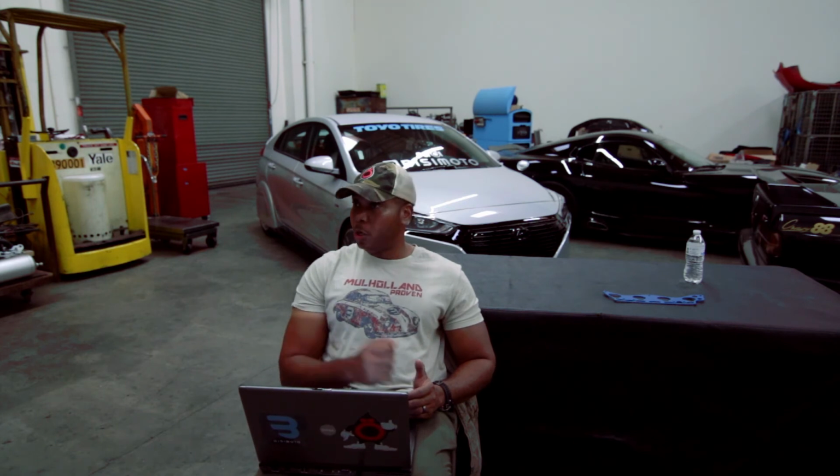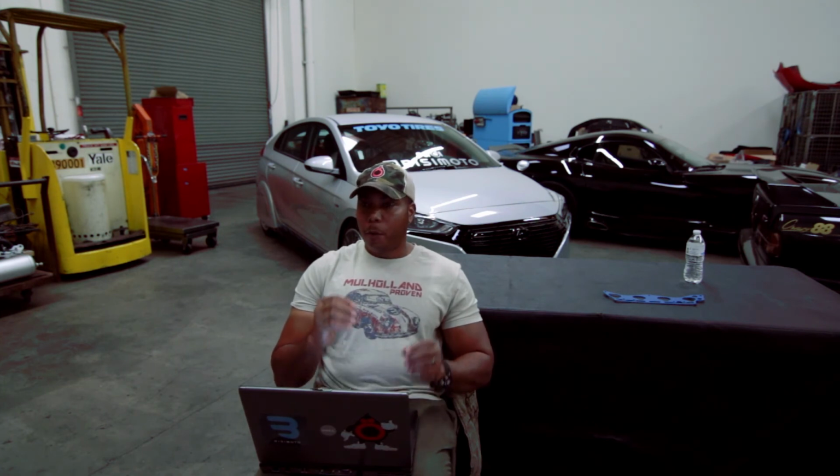And fast forward to today, he mentioned the IGBT coils from AEM, one of my partners. That coil pack is ridiculous. I make a joke sometimes that it could combust water. It cannot, but I'm so impressed with how, I think it's over 135 millijoules of energy. It's very, very robust. And with even a higher dwell setting for brief periods, it can even create more spark energy.